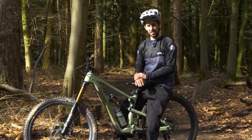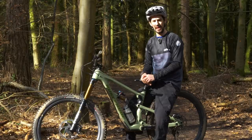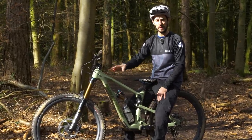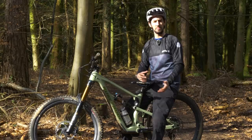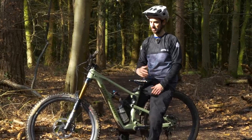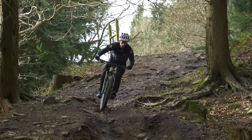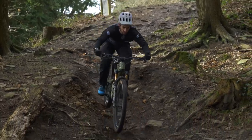Digging deeper into the tuning of your setup — I think this is where the biggest gains are to be made, especially on higher-end, more expensive suspension units, because you're going to have dials with more adjustability, which means you can be further off. With cheaper suspension you've got less chance to really dial it in, but it's going to be more likely to be okay. With high-end suspension, yes, it's brilliant, but you can get it really wrong and it can really affect how the bike rides.